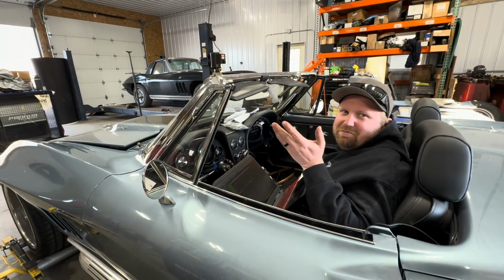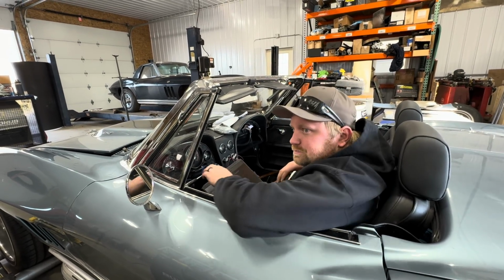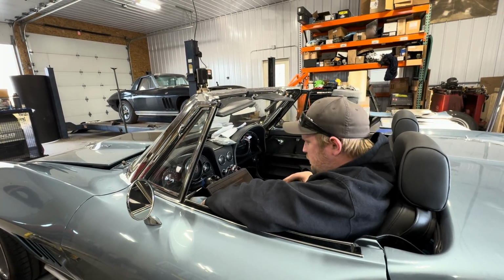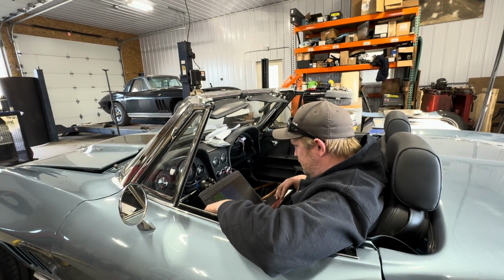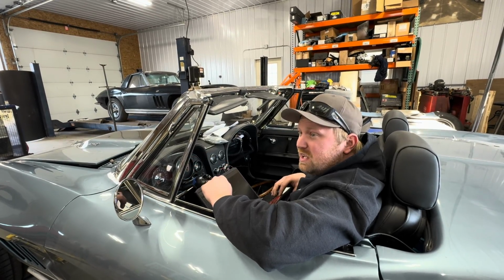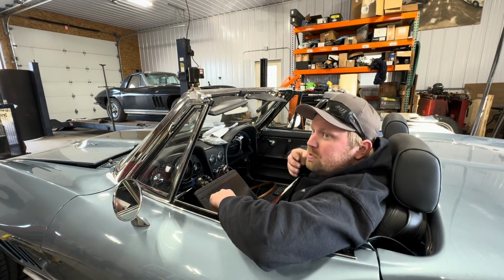Not bad. Don't let it heat soak. You can pick up 9 horsepower. Yeah. We'll probably just leave it there. Within 10 horsepower of what it made with HP Tuners. And to tell you the honest truth, I don't even know how good the tune was in HP Tuners. So I feel comfortable with this, 26 degrees of timing. I think we're almost at 28 on HP Tuners. So yeah, I'm happy with that.